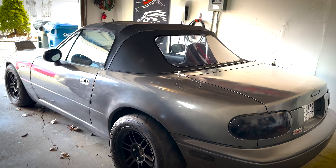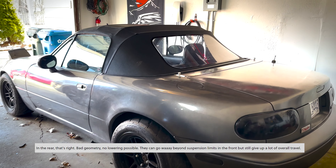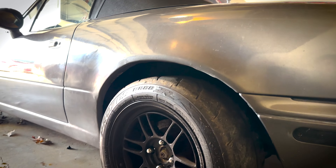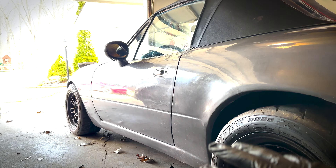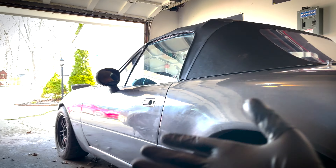I don't really want to ding Max Speeding Rods generally, because I have them on my Jeep and I've had them on other cars before, and they're not that bad. But for some reason, on the NA Miata - and I've seen other people complain about the same problem - on the rear, this is as low as you can get it, and you can see there's a pretty good gap there. This is the lowest point you can do with this coilover, versus in the front you can absolutely slam it to the ground and stuff the tire in the wheel well. But the rear, this is as low as you can get, so you'll never get an even consistency for what you want, unless you want to have ride height similar to what I have.